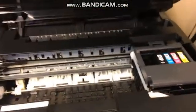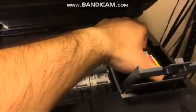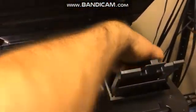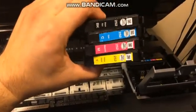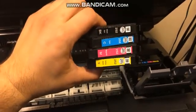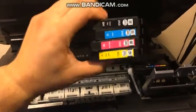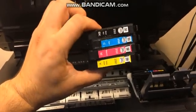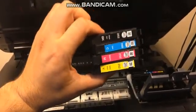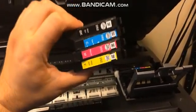The first thing you're going to want to do is check your ink. I have found that the main cause of having an issue with your print head or print quality is going to come from your ink. If you are running your ink too low, all the way down to the end of its cycle, that is what's going to be causing the problem. I'm going to leave a link in the description below where you can buy some brand new 252 Epson ink — make this project contingent upon getting that new ink.